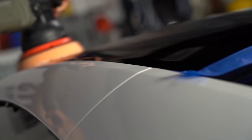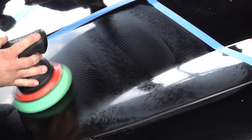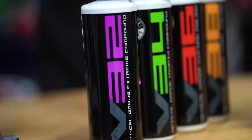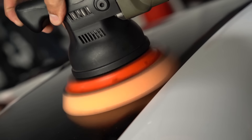If you have experience with rotaries, it's a very quick way to polish or restore the shine of your vehicle and get a professional result. Starting off with V-32, this is for really deep scratches and swirls that go through your clear coat down to your base coat, or just some really heavy oxidation. This is used with either a yellow or possibly an orange Hexlogic pad, using an aggressive abrasive which helps to diminish the clear coat and refine that flawless finish. But typically you can't finish with a compound, so you need to step it down to something like V-34.